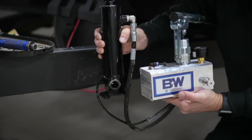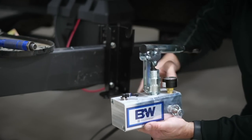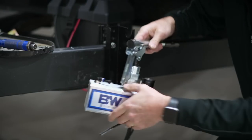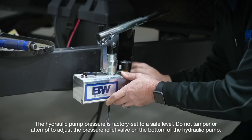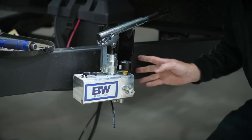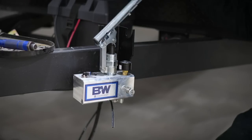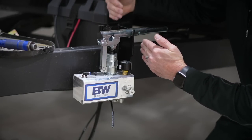Take your hydraulic pump and cylinder assembly and gently lay it underneath the trailer tongue, then mount the pump box to the bracket. You'll notice two holes on the end and a threaded hole on the bottom. The space between the fitting and the box slides over the tab on the bracket. Slide it into place and thread the 3/8 flanged head bolts into those holes by hand — two on the outside and one underneath. Before torquing these bolts down, push in on the handle to unlock it and extend it to make sure there are no obstructions on the trailer that would prevent operation of the pump handle. If you did have an obstruction, you'd need to re-loosen and adjust the pump mount bracket to allow for handle operation.